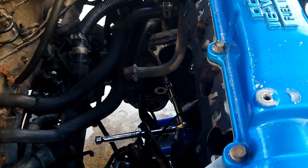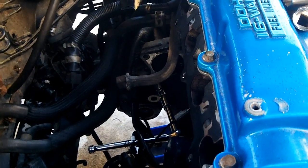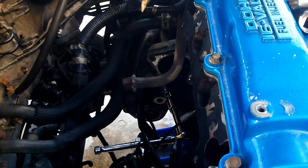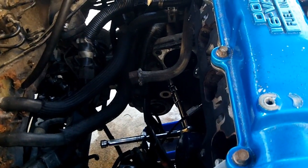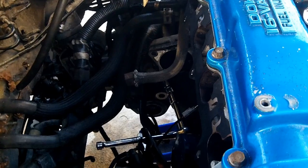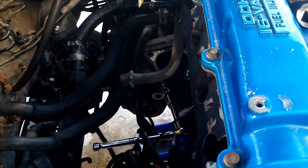Now the torque specs for this are pretty low, but it's misleading because that additional Loctite is used. It kind of raises the torque, it artificially inflates the torque value. So you're probably looking at about 75 pounds of torque in order to break that Loctite. And then once you break that Loctite, it's just like spinning off any other bolt in the car. It just comes off real easy. But breaking that Loctite is pretty hard.